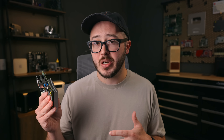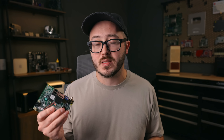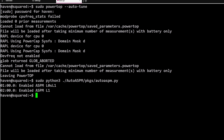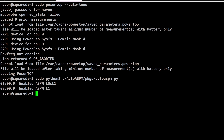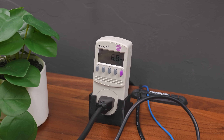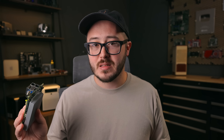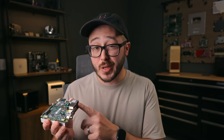Once I had an OS installed, the first thing I wanted to check was how low-powered this thing was. I made sure the HDMI cable was unplugged, then ran PowerTop auto-tune as well as an auto ASPM script. After all that, the power draw only dropped to around 6.8 watts — which is very low, though I was hoping it might be even lower. As I've said many times, it's not just the CPU drawing power at idle — you have memory, storage, network interfaces, and everything else on the motherboard.